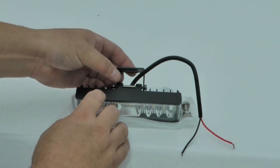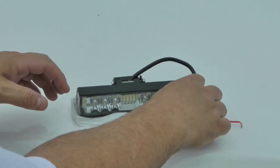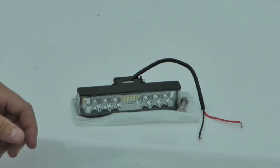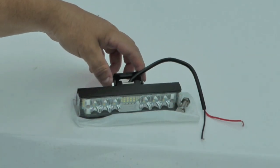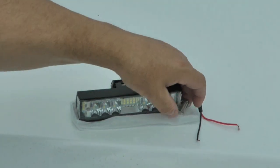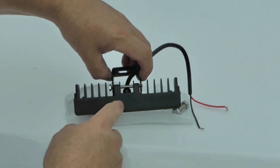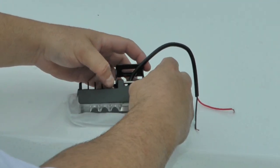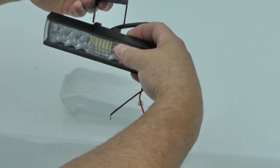It's a real simple installation. You have a small bolt that runs through there with a tiny nut, and then the bracket mounts to the vehicle with this bolt. The nice thing about the way they design the Crown Vic is there are lots of places where you can install this. I'm going to drill a hole in the metal about this size on both sides and the front, drop that mounting bracket in there, bolt it, put some Loctite on it so it doesn't come loose, and then put the light fixture in there.